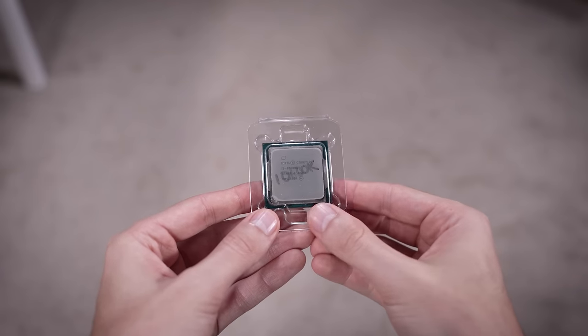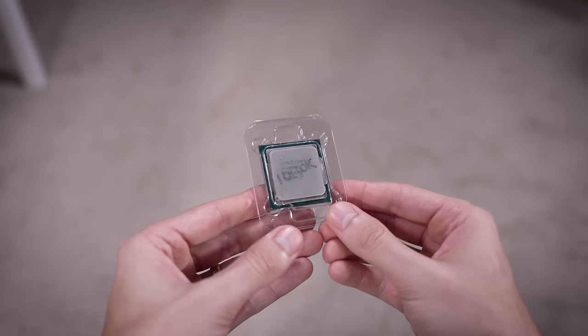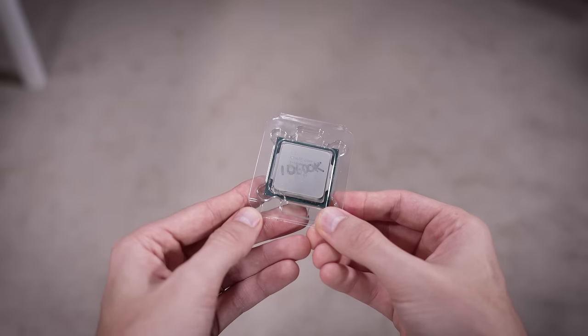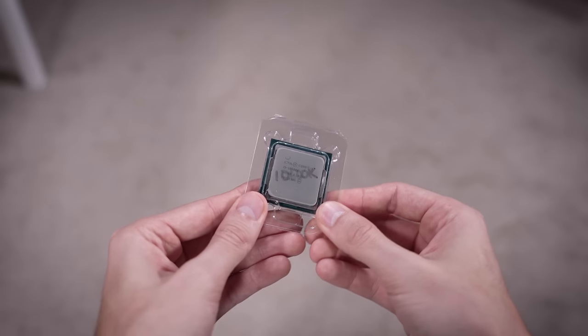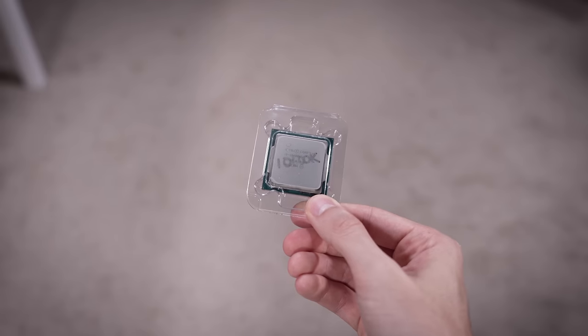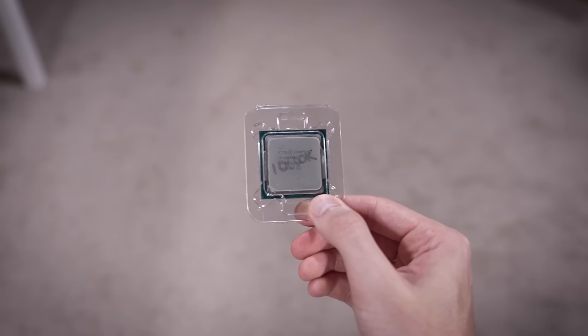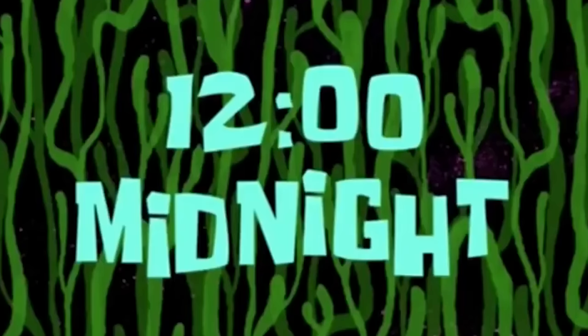So I don't have a choice — I'm just going to put one of my CPUs in there and see if we get the same symptoms. If we do, that'll rule out the CPU, and at that point I'll start looking at replacement motherboards. I actually have a 10600K as well as a 10900K. I don't really want to give him the 10900K for this kind of rig because his board has a locked chipset — it's a B-series board, so he's not going to be able to overclock.